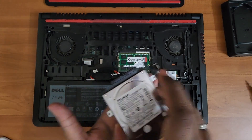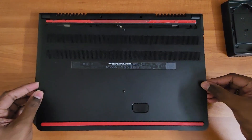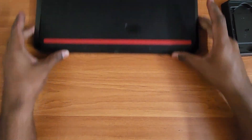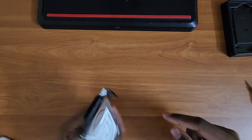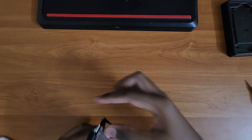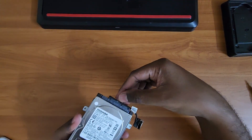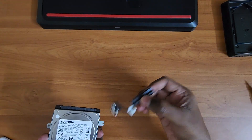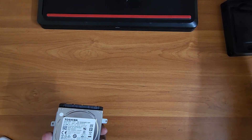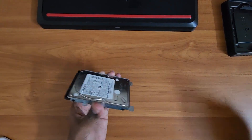This is a Toshiba hard disk that came with the laptop originally — it's a 1TB hard disk. Keep that aside safely. On the top there's a black connector attached to the cable; you need to gently tuck that flat plastic bit away from the hard disk, pull it gently and it should come out with a click. Keep that connector safely.